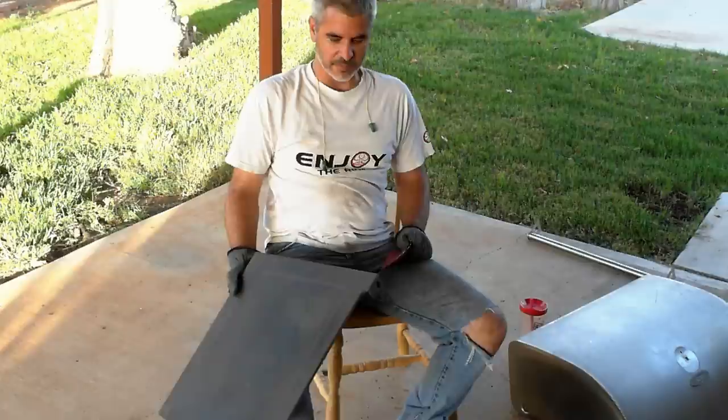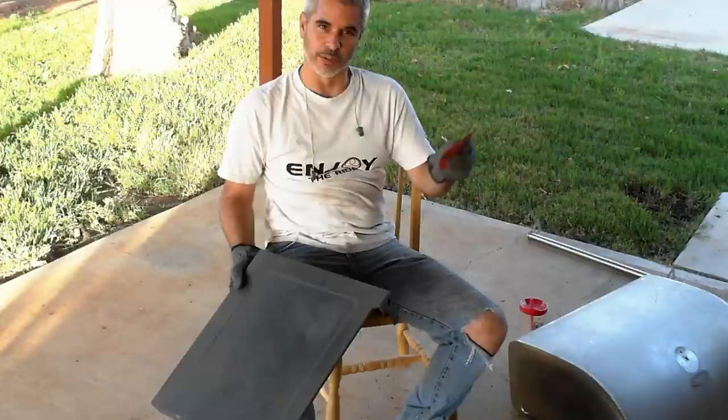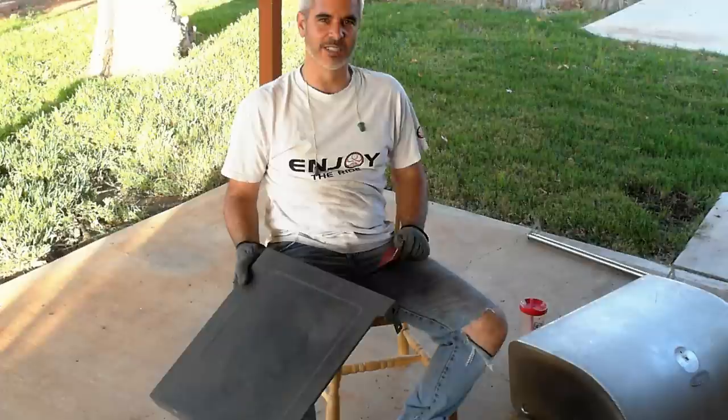If you've got greasy looking sandpaper, that means you're sanding through grease, so change the paper, otherwise you're just smearing grease around, and the paint won't stick to that. So it's kind of pointless to even sand unless you end up with a nice dry powder at the end.